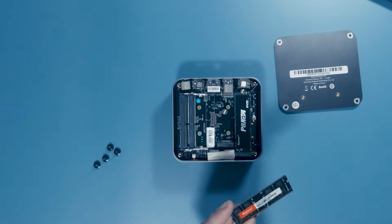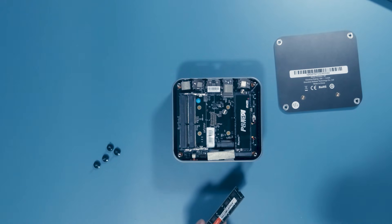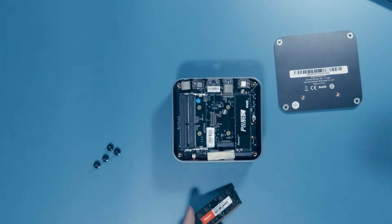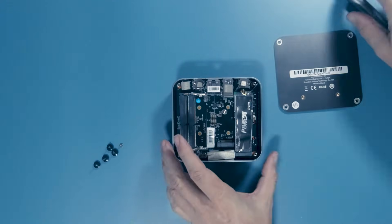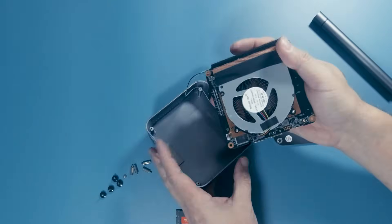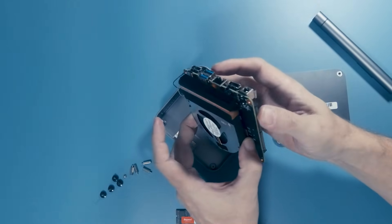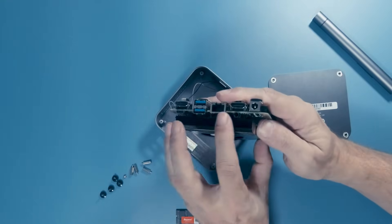The other thing I didn't like is that they place the Wi-Fi module under the SSD, and the SSD's cooling isn't properly implemented. The Wi-Fi module probably shouldn't be there because it gets a bit hot and in turn heats up the SSD as well. Above the SSD inside the case, there's only a single thermal pad — they could have used a longer one or two of them to dissipate heat from the entire surface of the SSD, transferring it to the casing. Both issues are actually very easy to fix: you can solve the cooling issue with a self-adhesive thermal pad, and adding another memory module gives you dual channel. These aren't critical issues. The machine looks just as good on the inside as on the outside — the soldering, PCB, and everything else looks perfect. The mounting of the connectors is also good and they won't break off the PCB prematurely. The machine can definitely be called high quality both inside and out.